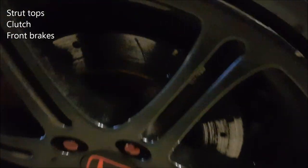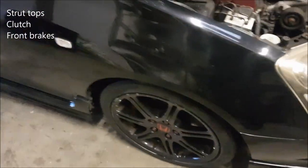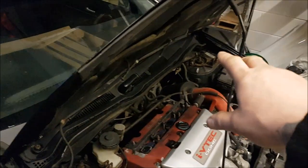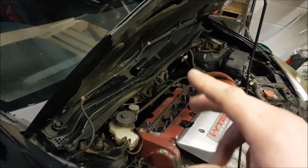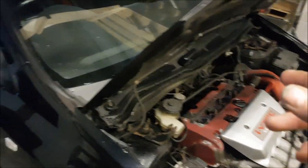Brakes — as you can see, the brakes have maybe seen better days. We're going to do a full overhaul on the brakes. The near-side caliper's actually sticking on the front, so we'll do a reseal on both calipers, and a new set of discs and pads.